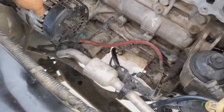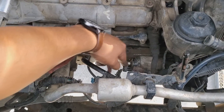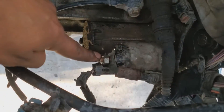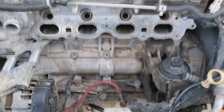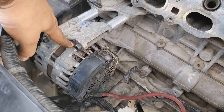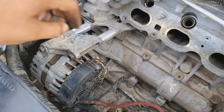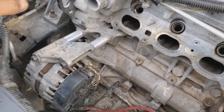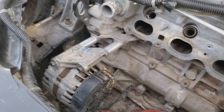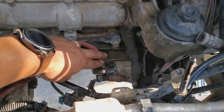I've already added the spacers, so what I'm gonna do now is reattach the power cord that goes from the alternator to the starter and tighten that 13 millimeter bolt or nut before I start mounting the intake manifold. One thing I forgot to mention: when putting in the new bolts that ZZP sends you for the alternator and the spacers, you can tighten all four bolts for the alternator and bracket at 15 foot pounds of torque.